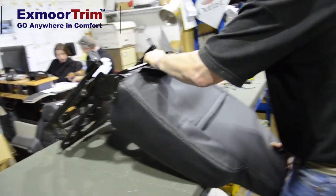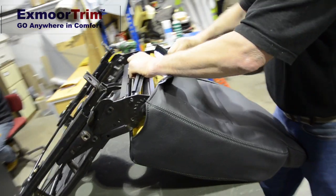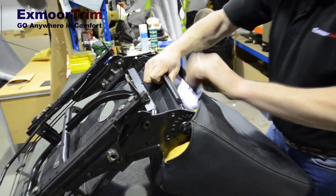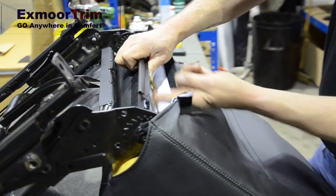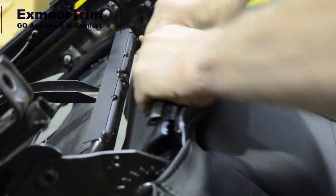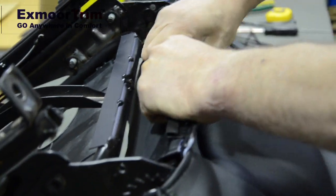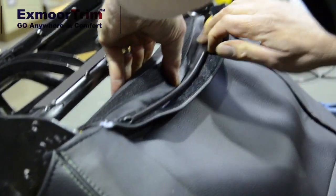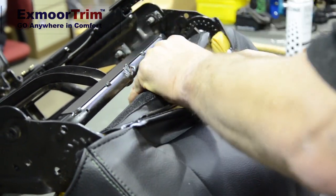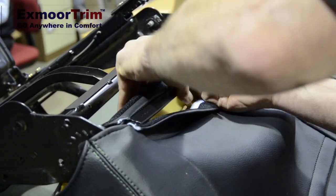Careful not to drag your new cover on your bench. This J-moulding has to be pulled around and clipped onto this back metal edge. A little bit hard to pull — pull it in the centre first, keep holding your hand on one end and get the edge started from one end and the rest should feed on lovely.